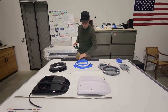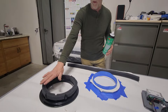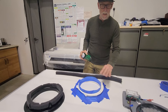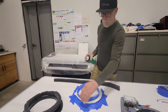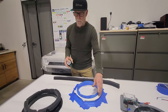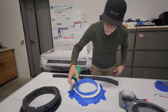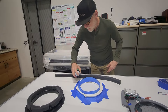This is the flange that goes on top of the vent — you can see I've already got this flange with the snow filter on there. Let me go through the steps quickly. I've got my trusty 3M 90 spray adhesive — high strength, high temp. I've masked off the part I'm going to spray on top of the flange, and I'm just going to spray some adhesive around on top of the flange to coat the whole top that's going to be underneath the cover.